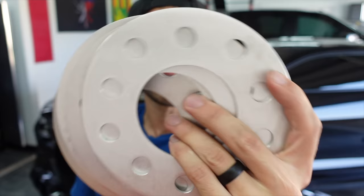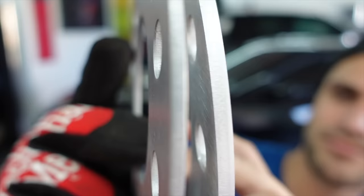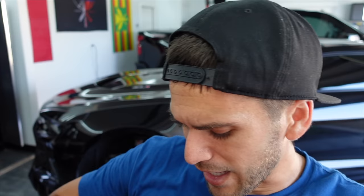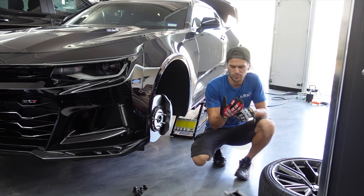We also have a goodie from GM — a carbon fiber gas cap. We also have black badges; I only bought one for now. Might be too much black, but I really like that matte black ZL1. Here are our spacers: 5mm and 3mm. They're tiny and they allow us to use our stock lug nuts. Big fan of Wildhammer right now because their shipping is so quick — I ordered this like two days ago. Slight correction: the fronts are technically the 3mm and the rears are the 5mm, but I'm going to try to switch them.